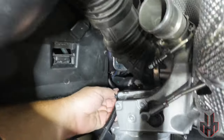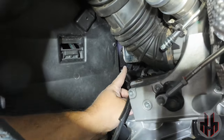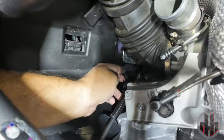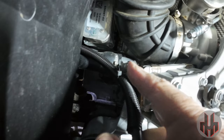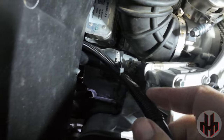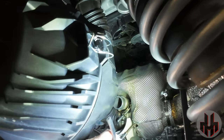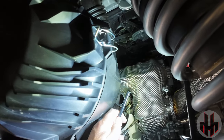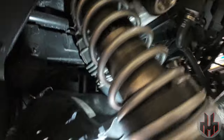Coming down through the lower gap — you can see the oil cooler right there, that was the concern about the upper one. I came through the lower one, ran some heat sheathing over the line, and loosely attached the line to the wiring harness — I think it's the temperature sending unit — to keep the line from dangling down into the driveline. You want all this excess length because it's going to be hard to reach the boost tube and get the clamp on. I took the boost tube off for this part of the installation.